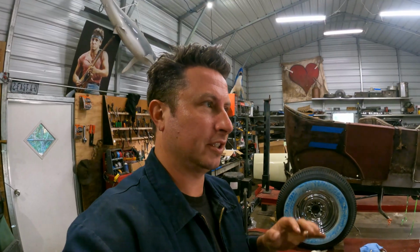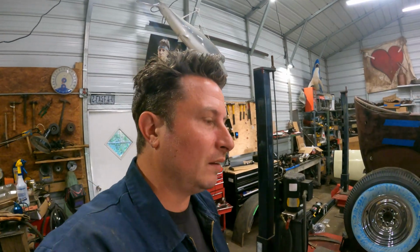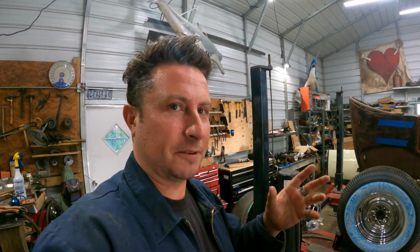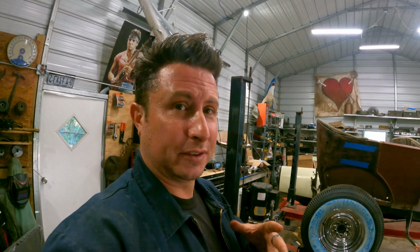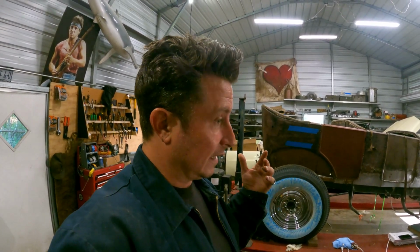My other thought was, and I would love to know if anybody out there has any experience with this, so I just clicked in on the old O'Reilly site, and the camshafts that come up for these small block Chevys on O'Reilly right now are made by Melling. And I thought, well, I don't know a lot about internal engine parts, but I do know that everybody and their cousin does and has always run a Melling oil pump. You know, if your camshaft fails, your engine doesn't necessarily go kablooey. If your oil pump fails, holy Moses, it's done, it's over. So I thought, well, everybody trusts Melling machine work on those things, then maybe the machine work on their camshaft's decent, and it's a stock style camshaft.